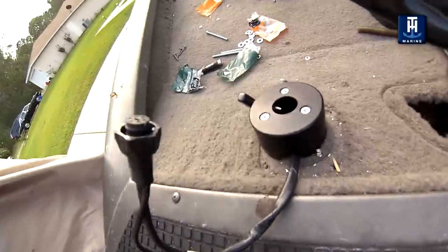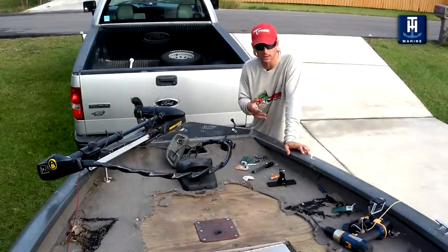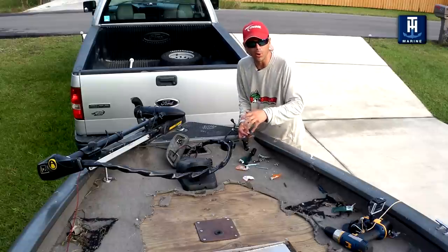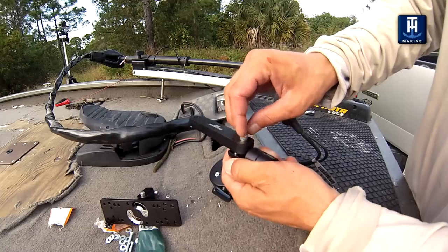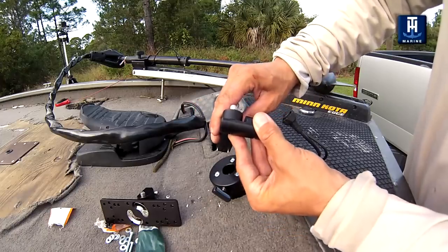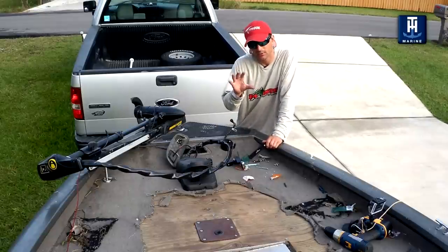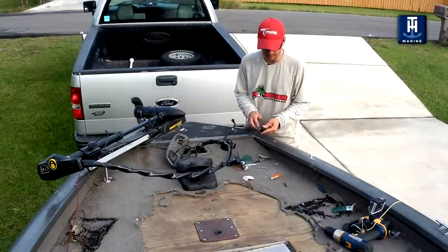A few sheet metal cuts later, we got this thing tightened down. You got to get out some wrenches and kind of run through the back end and then crank her down. Now we're just going to go ahead and mount the mounting bracket. This is what really makes the shock lock so beefy and so strong. As I mentioned earlier, there's no ball joints or anything like that involved. Everything is oriented with pin locks. Basically you'll have a hex screw, and then you'll loosen that hex screw and you have adjustability depending on where you drop those pins in. That's really why she isn't going to go anywhere — it's all metal all the way through. So it's not going to shift, it's not going to slip, and it really isn't even going to shake.